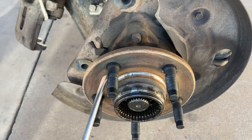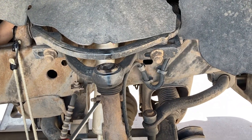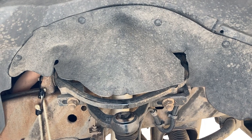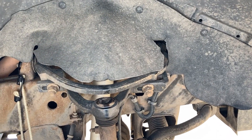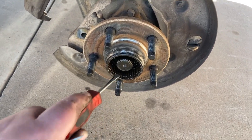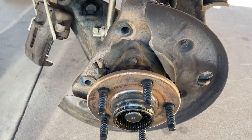We're on to getting the bearing unit off. What I'm actually going to do is look at the vacuum system here. I was going to do the ball joints, but I'm going to wait on the ball joints. Once I get this off, I'm going to take all this liner out because what I need to look at is behind there. One of the reasons I'm doing this all at once is so I can take this wheel liner out and deal with the vacuum lines that are all pinned behind it. This is going apart really easy — things are looking great. I did put some grease in here. I don't need to replace these, I just have new ones so I'm going to do it anyway.